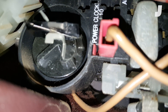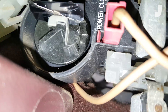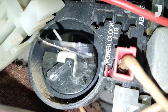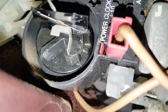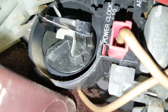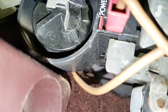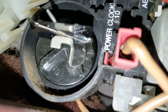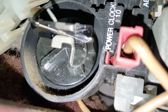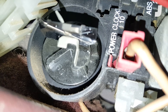Alright, focus camera — come on, you got this. Look at it. It's the most amazing thing I've ever seen. You can see the little contact right there. So there are two little terminals on this switch — there's that bottom one that's kind of hooked, and the top one is bending this bimetallic spring until it touches the bottom terminal and completes that circuit.